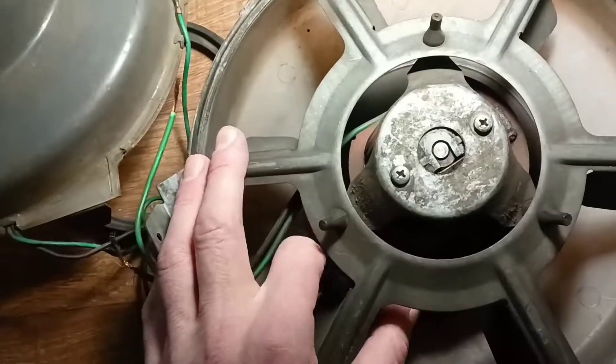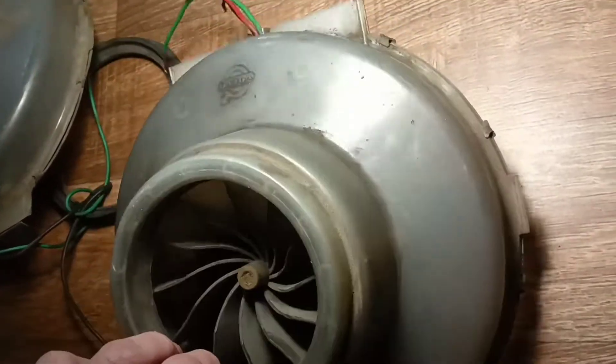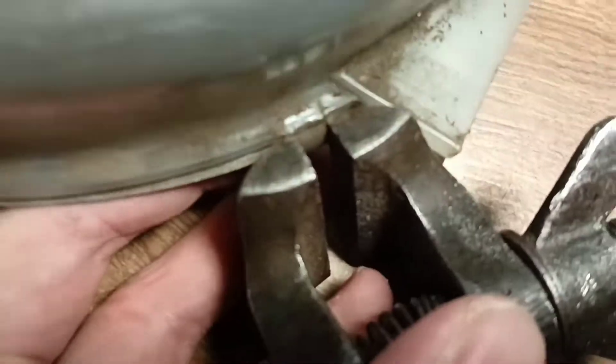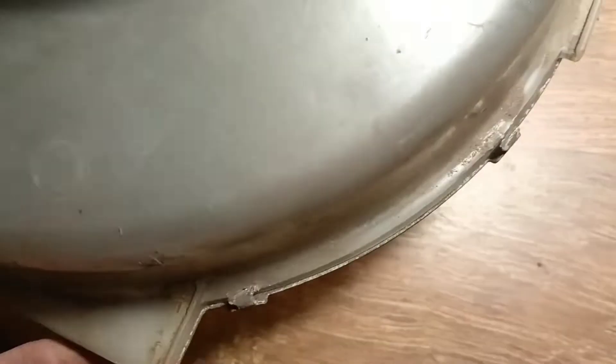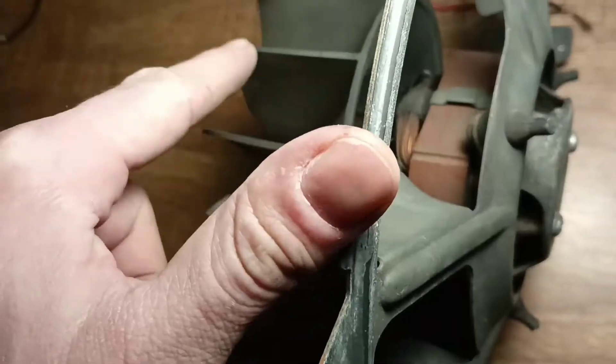On the lower side there are two screws for securing the motor, and three wires: black for ground, red and green for two different speeds. Let's open the casing and look at our motors. One of them is a little burnt inside. I cleaned the gaps between the contacts on the rotor. Now I can find the carbon brush on the cell — in the near future they will be replaced of course.